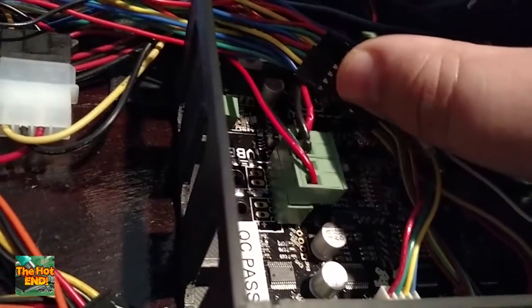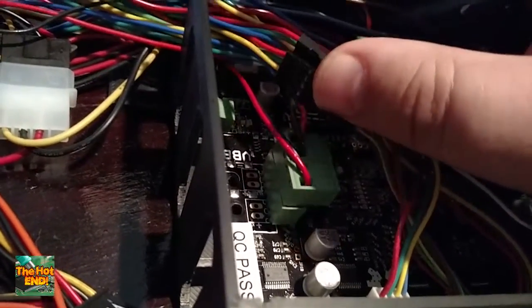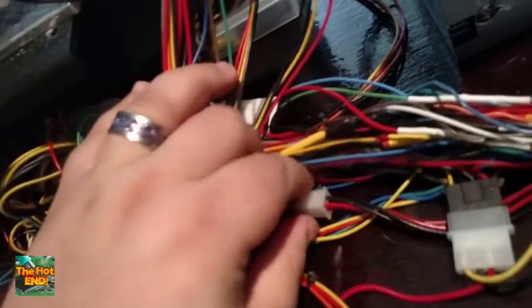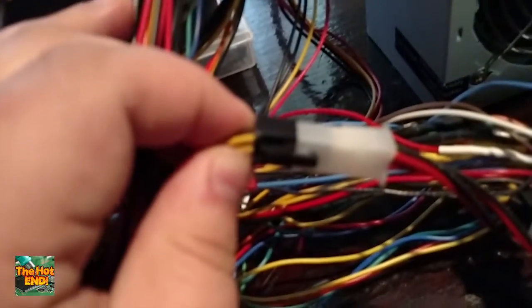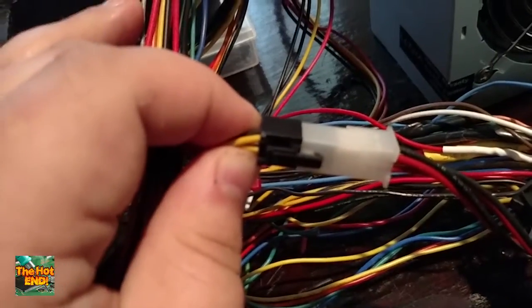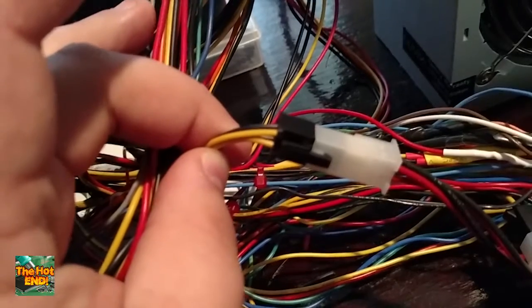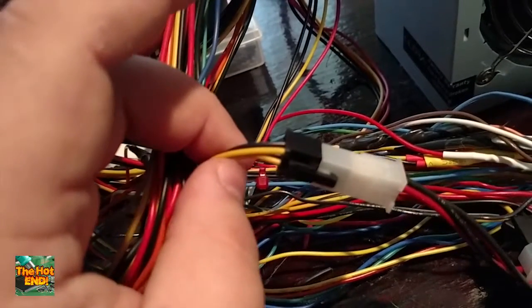Or you can use a Molex, but I don't recommend a Molex because it doesn't have enough power — it's not generally rated for that. The connector you're looking for is these small 4-pin CPUs right here. That's going to carry sufficient voltage and amperage to power everything you want off 12 volt. As you can see, yellow and black right there is pushing 12 volts out, which is what we want.